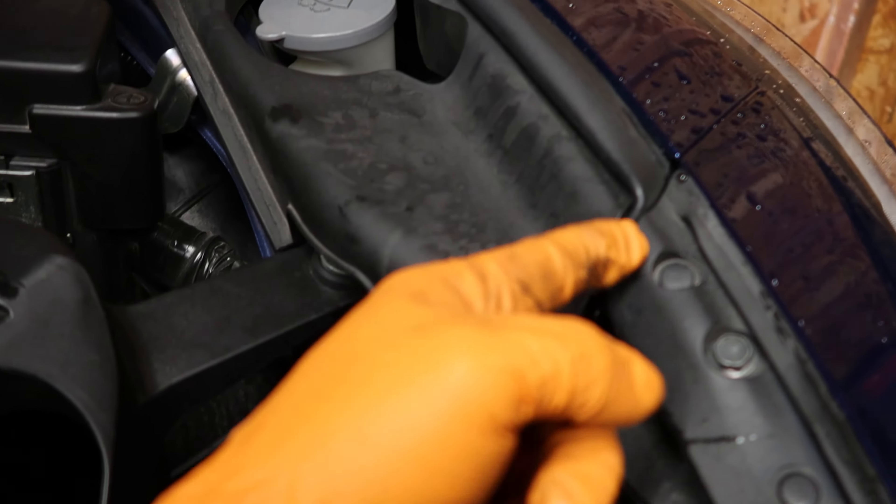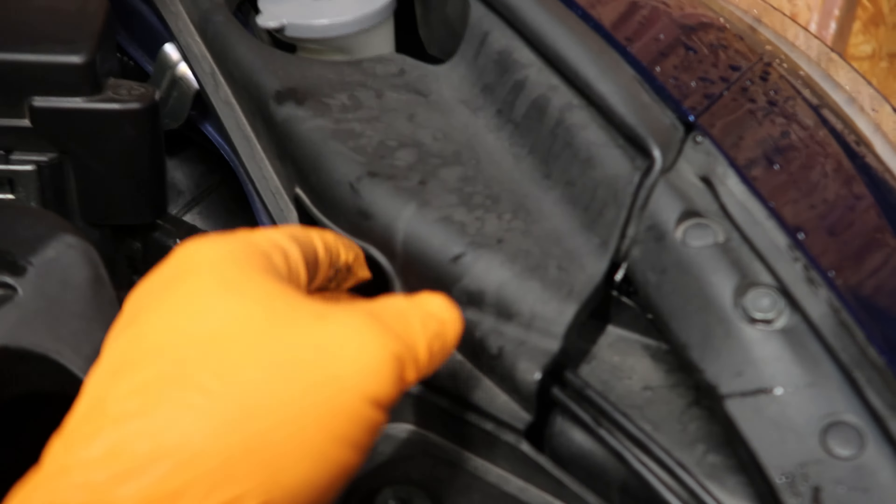So when taking off the front bumper, I heard it's hard to remember — there's a 10 millimeter bolt right back here on this side that holds the front on. You just lift this up, put a little wrench in there, take that off. Then I'm going to go underneath and see what's hooked up before I remove the top. I don't want it sagging forward and messing up the bottom mounting plates.